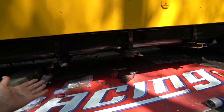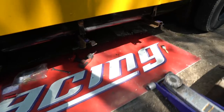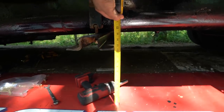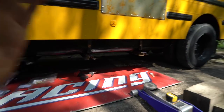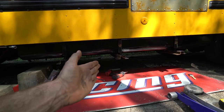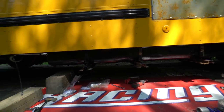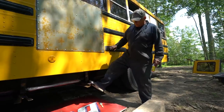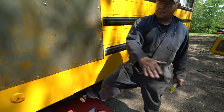The reason I didn't go with a round tank was ground clearance — it was really low. With this one we doubled the ground clearance to 11 inches. The other one was 8 inches. I feel like 8 inches in the middle of a bus is a little too low. If you go over a railroad track, 8 inches is not a lot — I don't want to get stuck and have this thing get demolished. We left these brackets on where the step was — that's where the outside fold-down deck will eventually go.